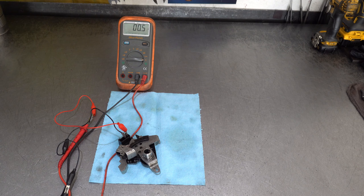A deep pan makes changing or draining the fluid a lot easier, less messy, and you have extra capacity — they add about three quarts for every pan across all makes and models. It's a good upgrade, especially if you live in a hot, arid, dry climate like I do. Transmission temperatures need to be kept under control.